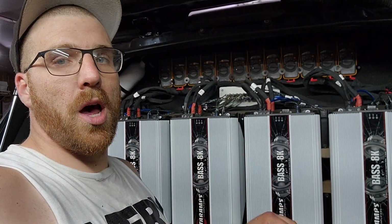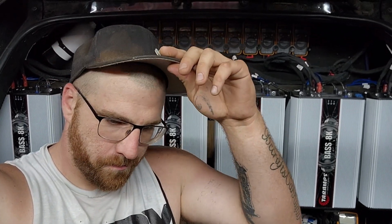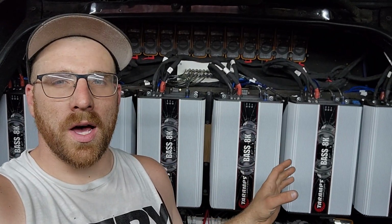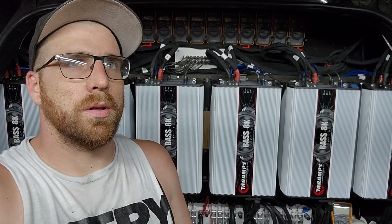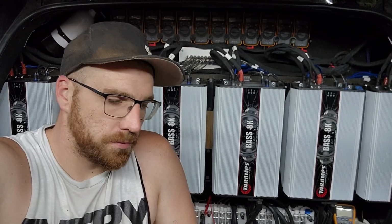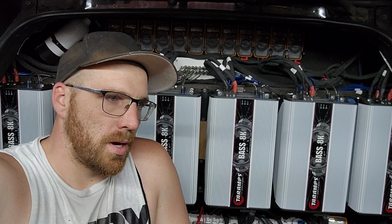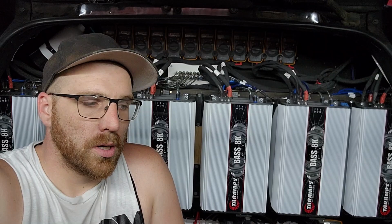Burps, knob all the way up, and I know I'm not peaking at 46, but I just tried a 46 tone, and all the way up is like 116. I want to be at 105, so I just turn it back one click, and all the way out on the knob was pretty close to 105. So I'm probably going to do that, or just turn the head unit up and go to about 3/4 volume, which was right at 102.